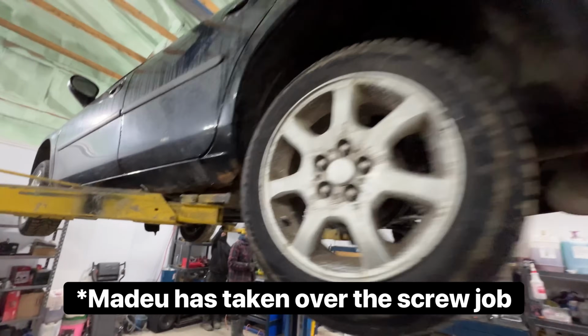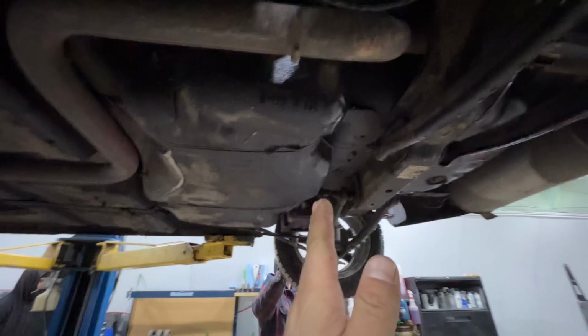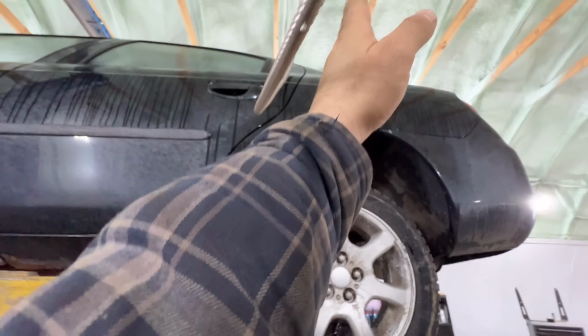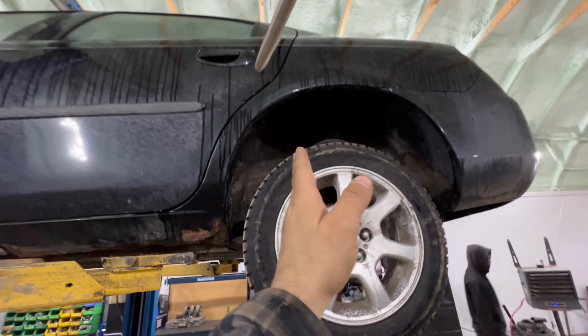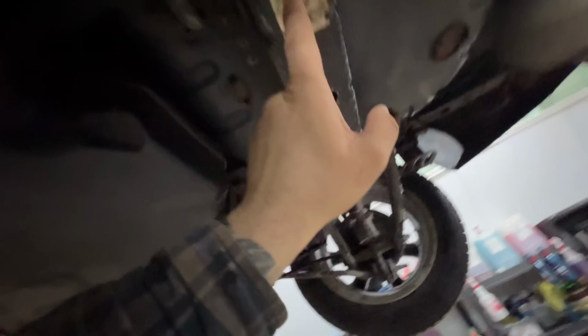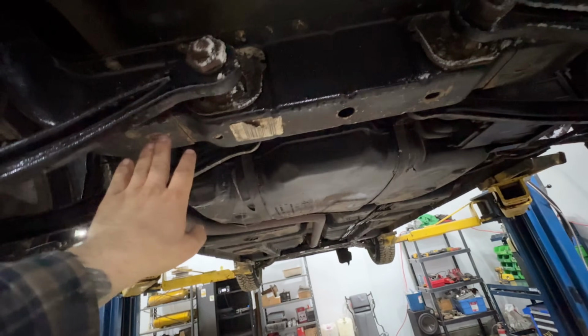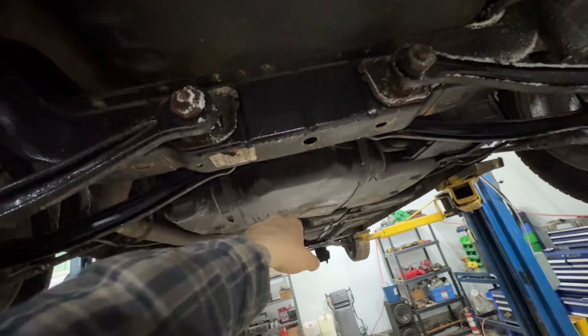It would appear as if the fuel tank is nice and forward to where we want to make our cut, which is right behind the rear door, so we can keep all 4 doors. So if it comes down here, it basically follows this line. We're going to keep this formed into the unibody here and then attach the rear of the hood to that, and then basically work our way forward.